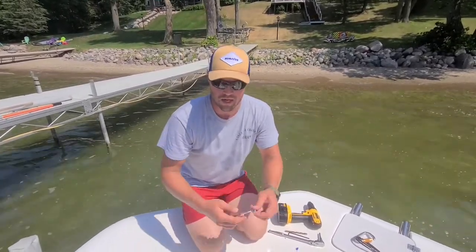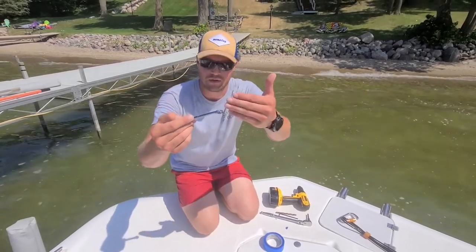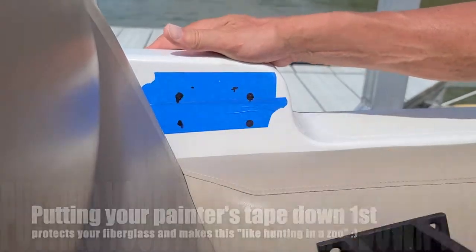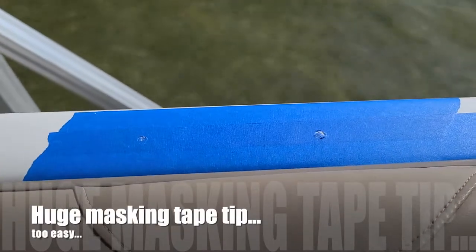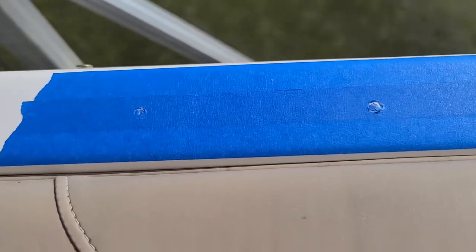We had to use this technique quite a bit. I was underneath some seats with my arm reaching as far as I could, holding the wrench like this — in a standard situation the nut would just drop out. What I have found best when drilling into fiberglass is to mask off your area with masking tape or painter's tape. It makes it really easy for marking out your holes and finding center, and when you drill them out, it will not flake away your gel coat or chip your fiberglass.